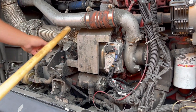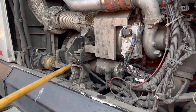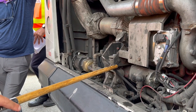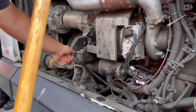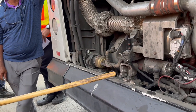My engine oil cap has the correct amount of tension and is properly mounted and secured with no leaks. My dipstick — tell me how it's done. With the engine oil dipstick, you're going to pull this out, wipe it with a cloth, insert it back, pull it out a second time and read it, and it should read at operational level.